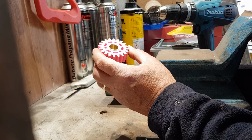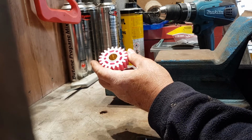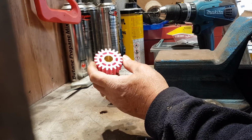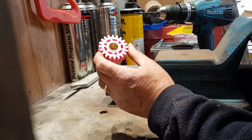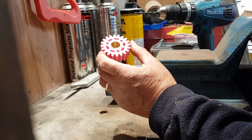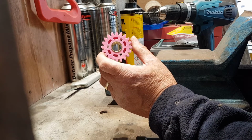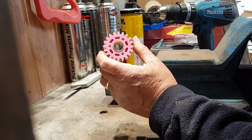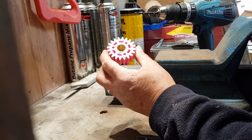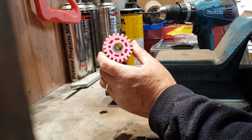But the first time I used my Suffolk Punch, which was actually a reconditioned model, it's a 17S, so it's quite a wide cut, I got halfway through and this thing decided to shatter. It's quite a common occurrence, and they are designed to shatter because if you get your cutting blades jammed with a stone or something, a large twig that it can't cut through, then these self-destruct before you do any damage to anything else.